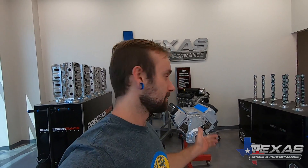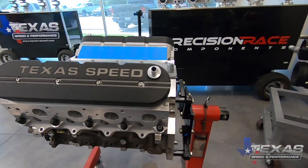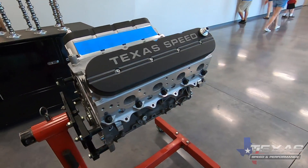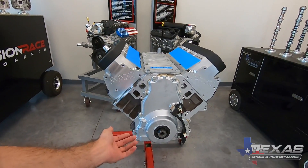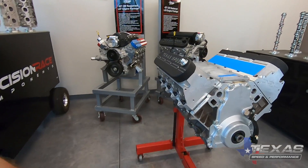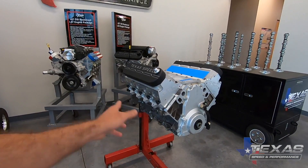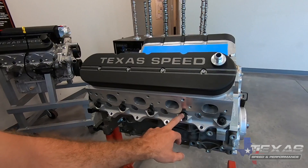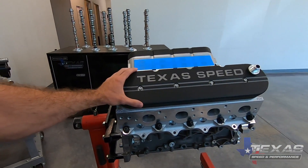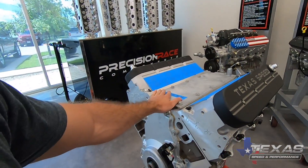Chris's engine is all finished up and ready to ship out — it's about to head out the door to him in a couple hours. They've got to build the crate and get it all set up, but here it is pretty much finished. A little bit of info on the engine: it's got our Texas Speed billet I-beam rods, a Dart center-weighted crankshaft, Wiseco pistons, a Texas Speed re-sleeved LS block at 430 cubic inches overall, and a set of PRC-260 LS3 heads. It's got ARP main studs and half-inch head studs, with black Texas Speed valve covers with gray lettering.